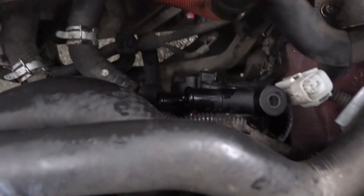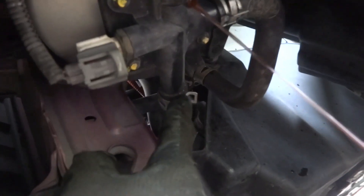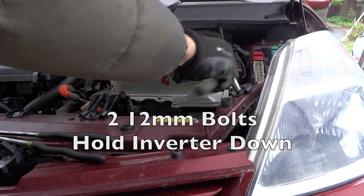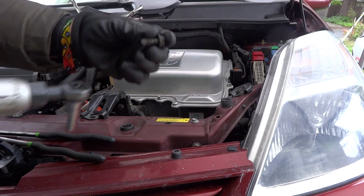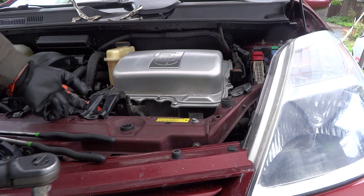Now is the trick that you've all been waiting for. Those two top hoses are removed — those are easy. You don't even really need to plug them. There's no need for special tools. When you're draining the coolant, they're not really dripping at all. It's a good thing you mark the bottom one because they can both look very similar. Most people struggle with that lower hose — we're not going to remove it from there. We're going to remove it from this tank. On this tank, it's this hose. We just remove that hose and pull the whole thing out the top with these two bolts that are holding it. If you want more space, you can remove them from the actual inverter. Be gentle. Now is when you make the space to be able to pull that pump out.